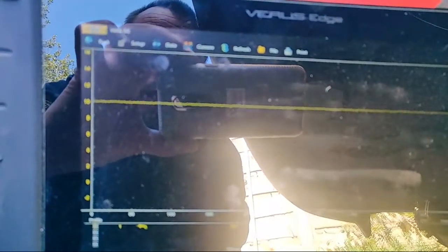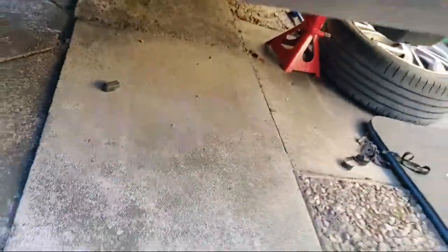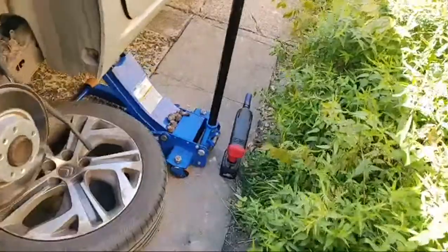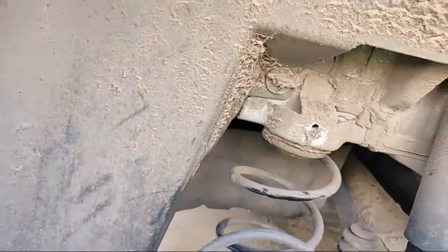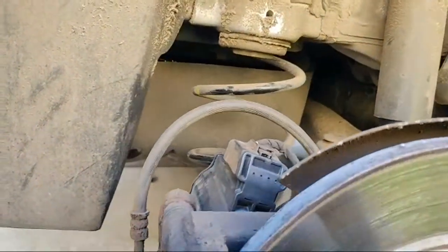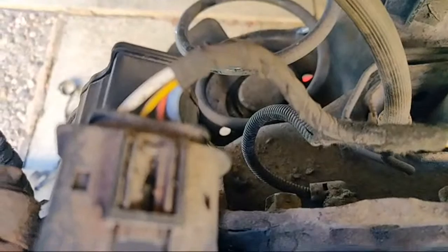The other wire is at zero volts at this time. So I need to find 10 volts on that red wire - let's go over to the other side of the vehicle. On the faulty side I can see a thick blue wire, a red/yellow wire, and a white wire. I'm going to back-probe that red wire.